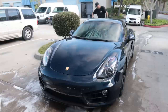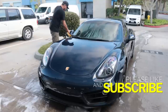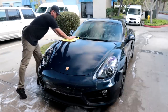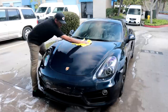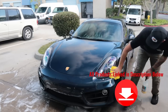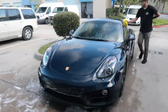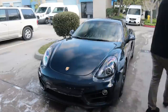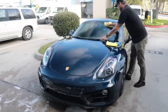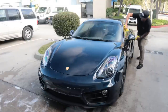For the very first part of drying, I'm just using the towel dry on the hood — I have three products on the hood I've been testing, so I don't want to add any extra protection there. For the rest of the car, I'm taking a fresh towel and spraying a couple sprays of Technician's Choice Ceramic Detail Spray to use as a drying aid. This product is super slick, so I'll spray it on the towel and absorb the remaining water while introducing lubrication to reduce any chance of marring or scratching the paint. For windows, I'm just using water and a microfiber towel.